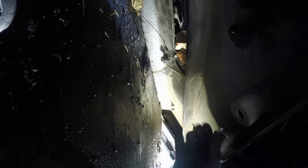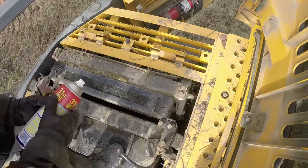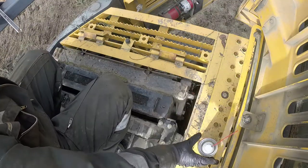We moved back underneath. Now it's time to completely remove those four mounting bolts for the radiator down at the bracket — we just broke them loose earlier. Let's get them out. Then let's get back to the top and undo that small cover plate for the oil cooler.